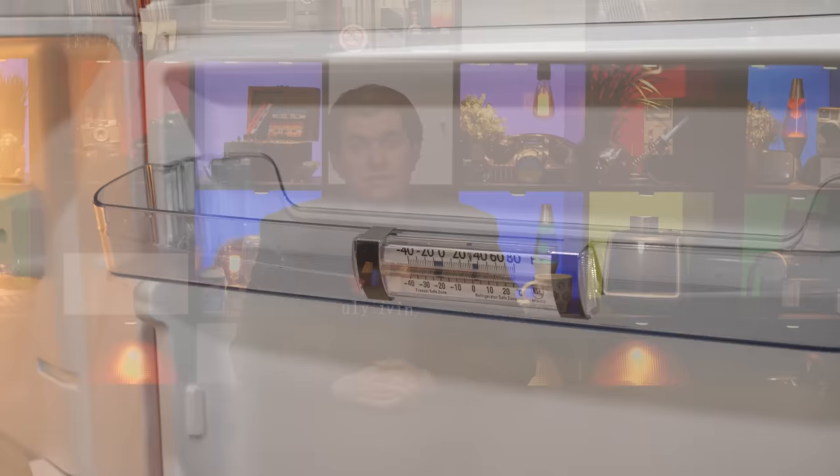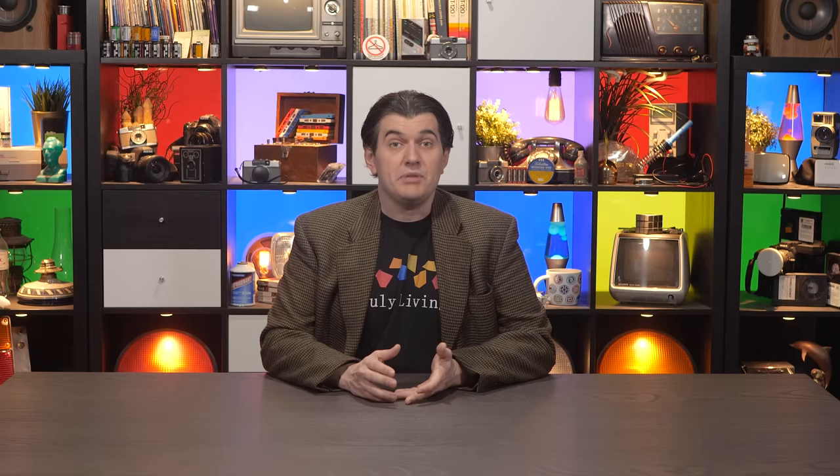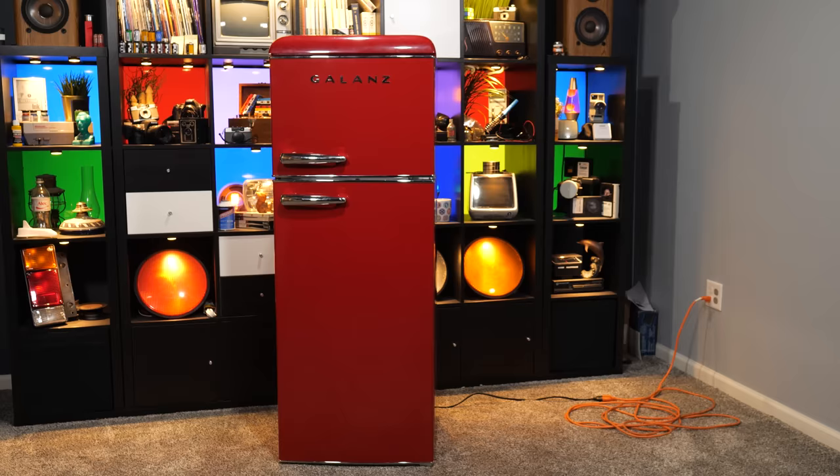But just because something's clever doesn't necessarily mean it's good. When I was using it as my main fridge, I had a fridge thermometer hanging from this shelf on the door to make sure it stayed within food-safe temperature, and I'm happy to report that it did. But barely. It was clear that its refrigeration circuit is adequate at best. Just putting in the mildly warm leftovers in a casserole dish would elevate the temperature beyond safe limits for an hour or two. The compressor is an adorable little thing, and somehow that's gotta cool down a fairly large fridge, so that wasn't much of a surprise. But it was still concerning.